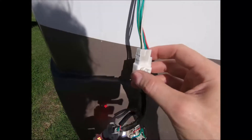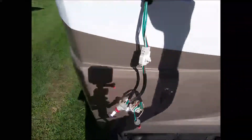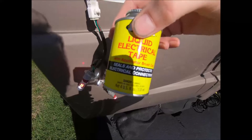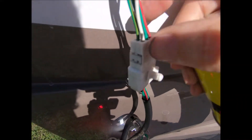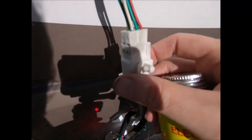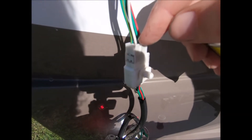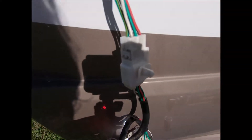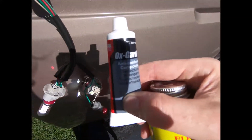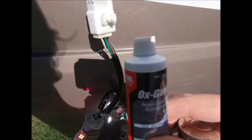To make a little better connection - I still don't like how this is designed, because the wiring harness just sits right down in here and all the moisture from the ground flows up in there keeping it damp. I've got this liquid electrical tape and I'll put it around these wires on both sides to seal the connector and keep the moisture out. You know, automotive connections around engines all have silicone rubber on the back and rubber seals in the middle. I'll also use OxGuard on the connections in here to keep them clean and prevent corrosion.